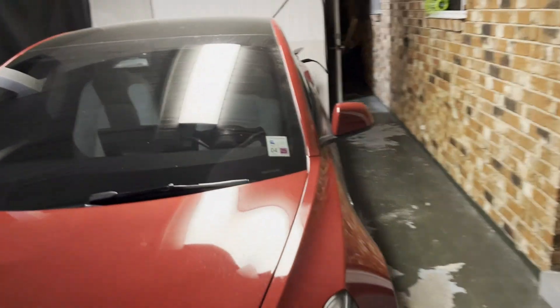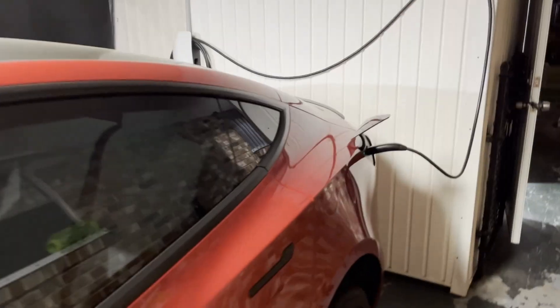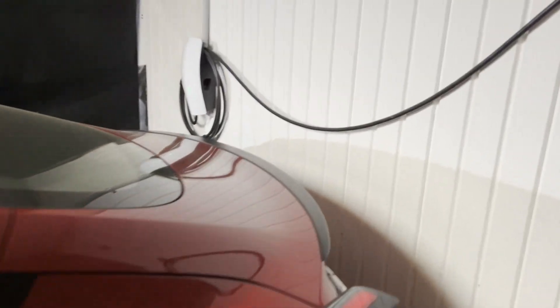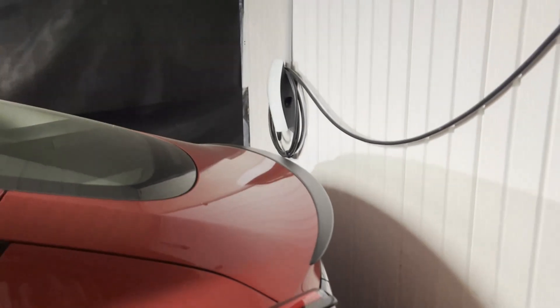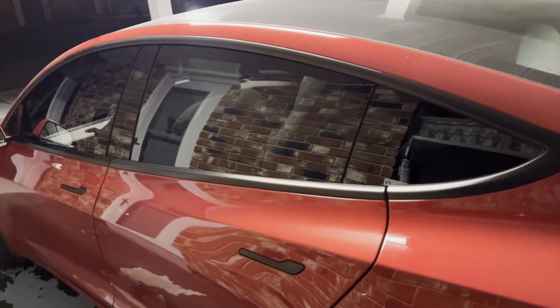Hopefully this video is helpful to some people. If you bring your car to Tesla service, let them know — hey, could you check my wheel speed sensors? Because the error may be related to that. Which is exactly what I told my service team, and when they did, they found out that the error was related to the wheel speed sensor.